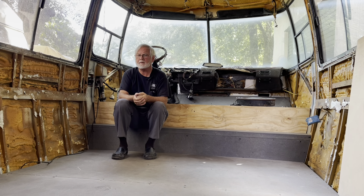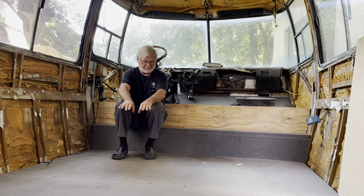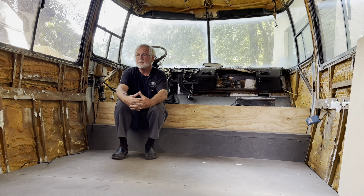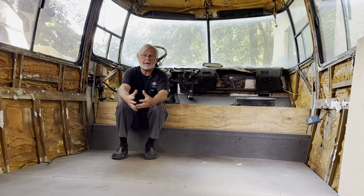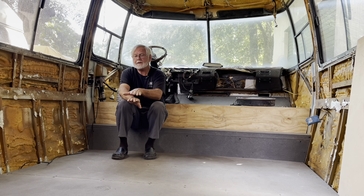If your floor has major damage — wood rot, things going on, pieces not lined up — take the interior out. You have to take the interior out to do it, then take the floor up and do all of this. When you build your investment back up, you'll have a really good floor, better handling characteristics, and it'll be quieter because there'll be a decoupling of the frame to the body, which will help you greatly.